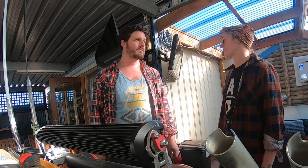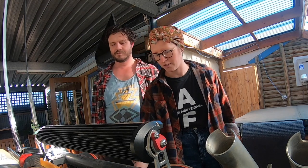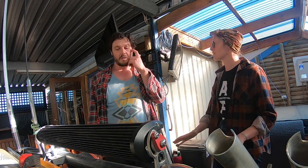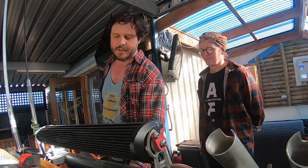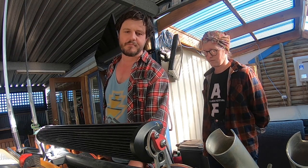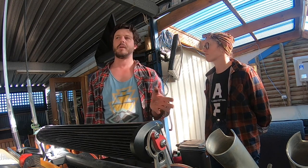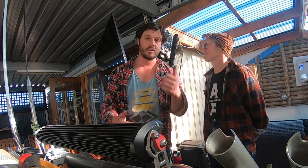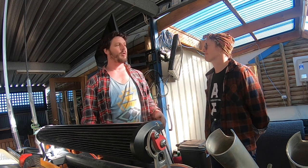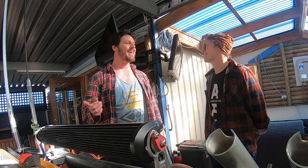The whole point of this is that when we were in Tassie, you were saying wouldn't it be great if we had an in-cab switch — rather than having to come out and attach the controller onto the front of the truck. There has to be a way of putting an in-cab switch in. Because I also noticed that the little plug here, the contacts in here, are starting to go a bit green from corrosion, and I thought maybe that could fail one day. So an in-cab switch will give us redundancy there if that fails. You can use both — the external controller or winch from inside the cab using an in-built controller. We've done that, we've wired it up, and we'll explain how that all works.